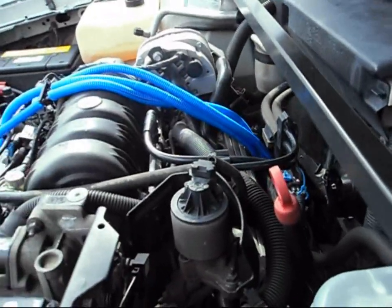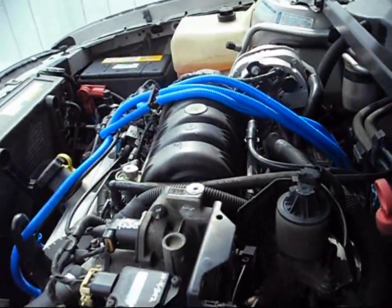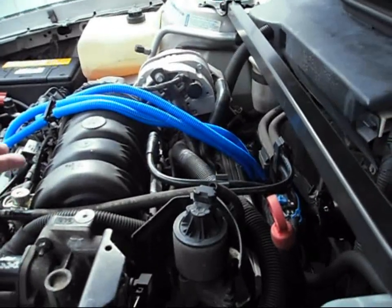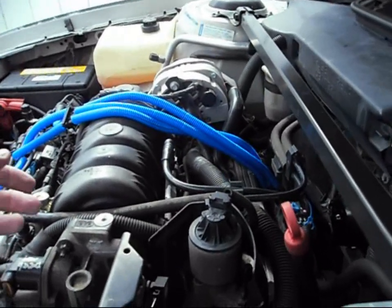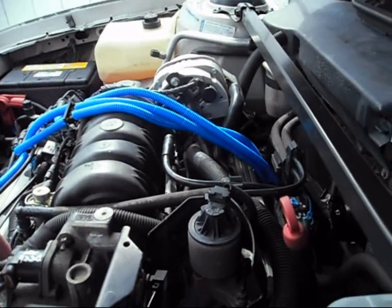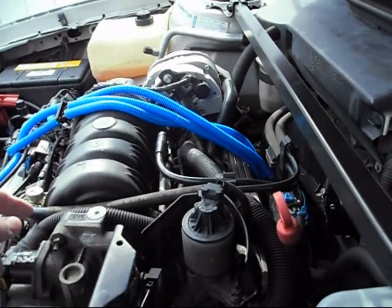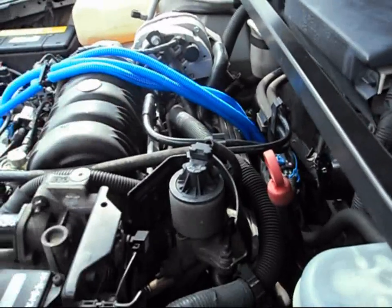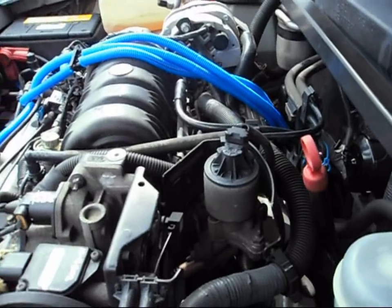The three spark plugs in the back are a little tricky. As I showed in my previous video, you actually have to remove this — you can remove the fuel rail. I'm going to do this in probably about a month, just getting everything ready ahead of time. You can remove it while it's still charged — just hang it up on a wire so you don't have to depressurize everything if you don't want to. The kit comes with new O-rings and all that.